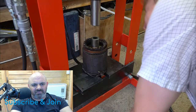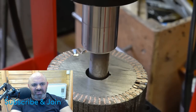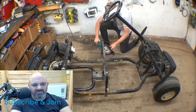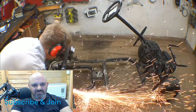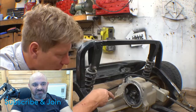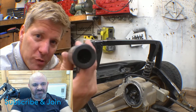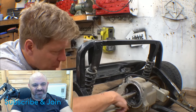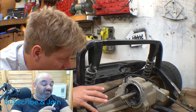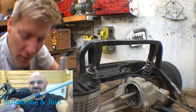You don't appear to want to come out of there, do you? I've just made it smaller, essentially. Right, that's got it stripped. Steering's good, nice suspension, motor. Bashed it off, tried to press the middle out — didn't work. Cut it in half, then pressed the middle out, and that's given me this little spline shaft. We can whack that on there, put some plates around, stick a bearing on it, and then stick another electric motor on it. I don't want to do petrol because the sound of a petrol engine is not very Star Wars. This one had a 2.2 kilowatt motor, and the one I'm replacing it with is 30 kilowatts — should give us a bit more.